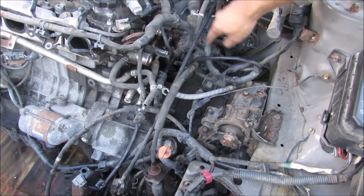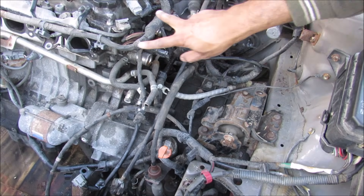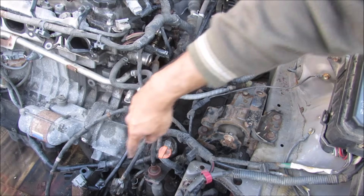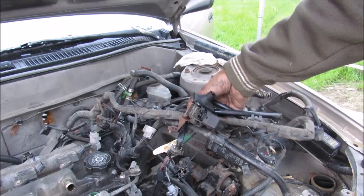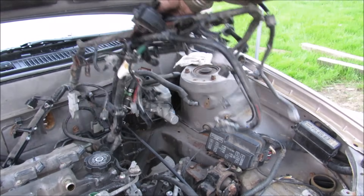Next I'm going to start tackling all the wiring coming out of the firewall here. It goes up to the valve cover and splits on both sides, then it goes over to the starter motor over there, the battery over here, and the fuse box over here. I've got the entire electrical wiring harness free from the engine.